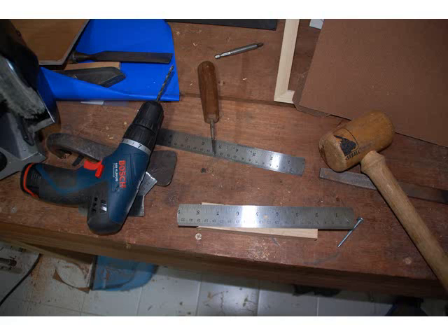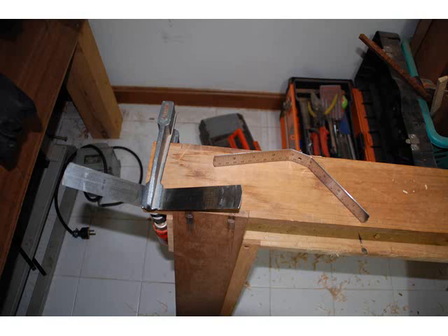Mark the center of the springs and drill a suitable hole. One half inch in from the hole on each side, make a suitable bend. In this case I probably should have done about half that amount of bend — it would have been fine.